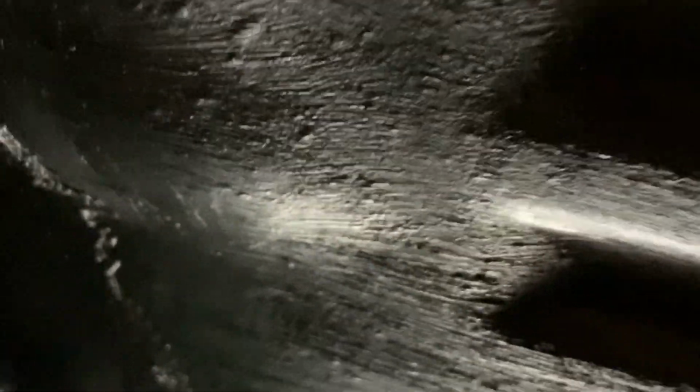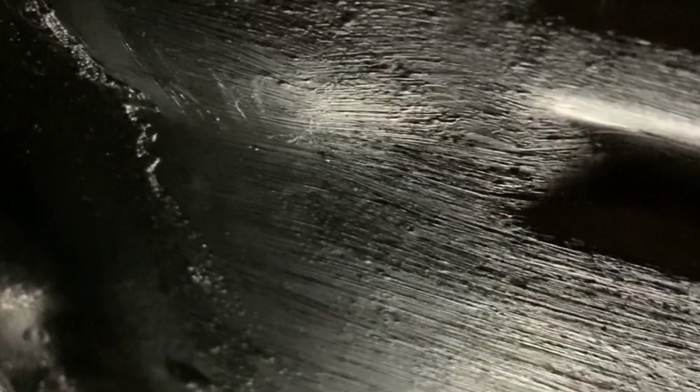I'll show you a better shot in a minute, but yeah, what we've done is as best as possible, this isn't a perfect restoration, but as best as possible, wire brush, wire wheel, all sorts of abrasive tools to get down to bare metal. Then use a rust preventative, like a spray primer, zinc based, then black paint, and then underseal as well. So it's had a few layers of everything, and we're trying to do that everywhere under the car, as you can see. I'll try and get a better shot as well.